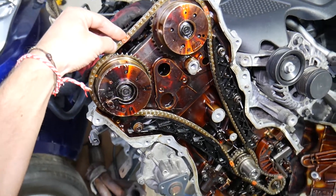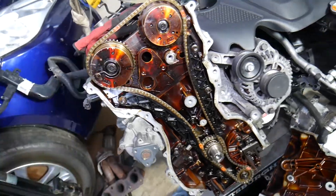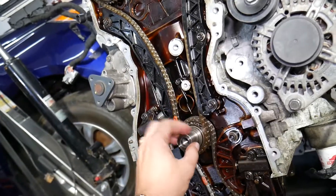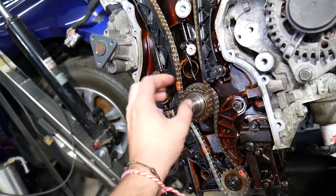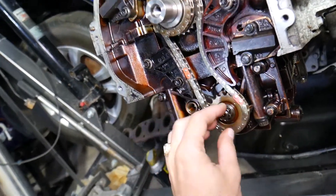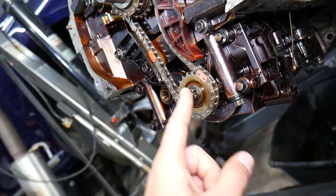In my opinion it's not, and we have videos to prove it. So if you want to see when to replace the timing chain on a GDI engine, check out the videos on our channel. Now, you have the main timing chain that moves from the crankshaft up to the camshaft, and then you have a secondary chain. That secondary chain drives the oil pump.